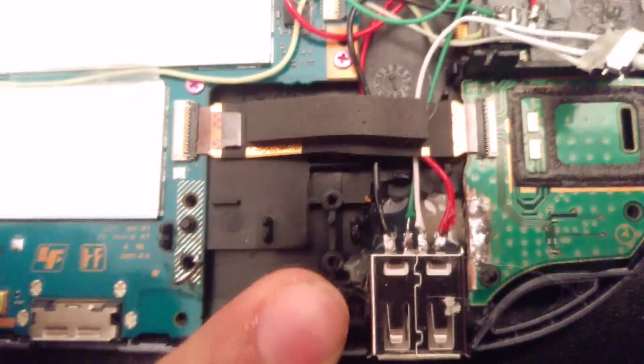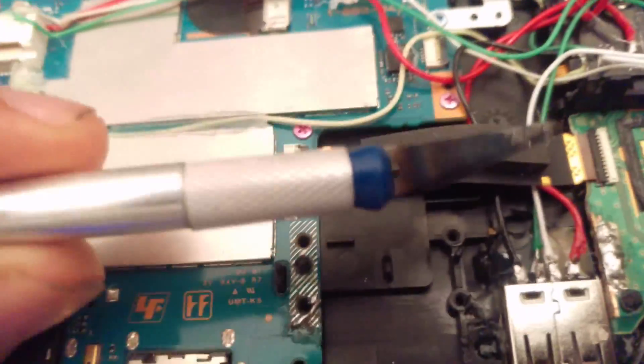How I cut the case was I used an X-Acto knife — specifically a heated one. I heated it up and it glided through the plastic like butter without leaving annoying burn marks. To fit the USB port, you're going to have to cut through the outer layer until you get to the skin part, and you'll actually have to cut the PCB as well. On the back case — even though I did a rough job and you can literally see the burnt plastic — you're going to have to do a tiny cut, cut this part quite a bit, and cut the part of the battery section that hangs there.